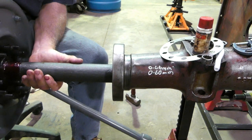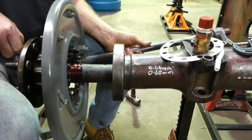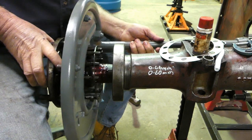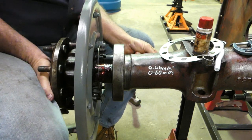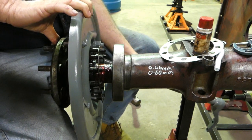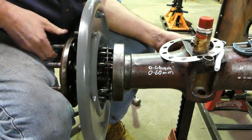And you do get to a stage where the axle sits inside the axle housing a bit, but you can still stop it rubbing against the seal. So we're just coming up into the diff there. Now, you can set these up wrong. You need to make sure that your brake rod going across to the housing is all lined up. And we're entering the diff there.